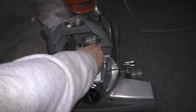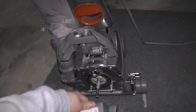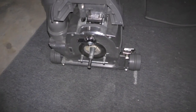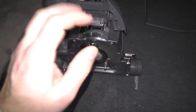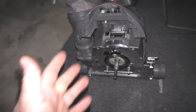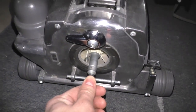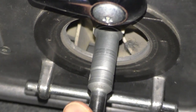So I had been doing some construction in that particular room that I was vacuuming, and I must have left a small wood screw on the floor, and it got sucked in, because Kirbys will take in anything that you give them, but it hit the impeller just the right way, and it chipped it. In fact, you can see there's a chunk missing out of one of these vanes. Let's take a good look here, see if we can figure out which one it was.